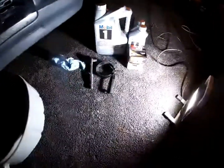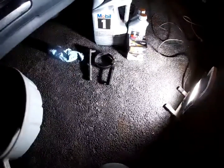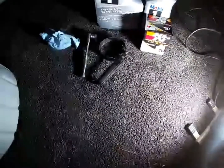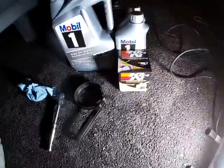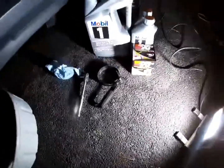It's been a while since I put a video up, so I figured I'd do a quick short video and show you how to change oil in a 2011 Dodge Durango Hemi. It'll be the same from 2011 up as long as you've got the 5.7 in it. Things you're going to need: a drain pan obviously, a three-and-a-half to four-inch filter wrench, a 16 millimeter socket for the drain plug, seven quarts of 5W20, and a K&N oil filter HP-2010. Let's get this started.